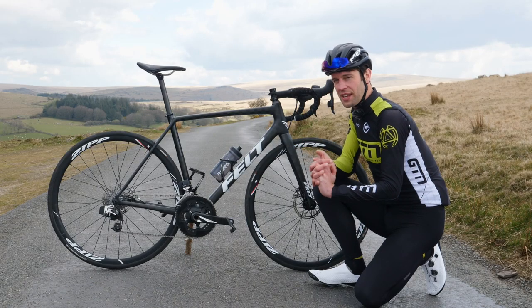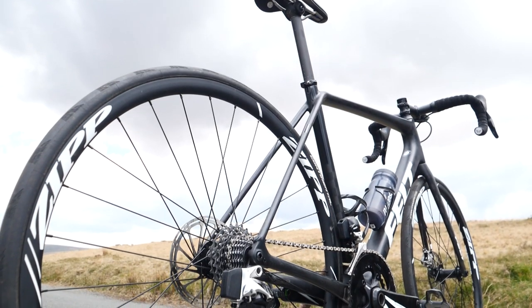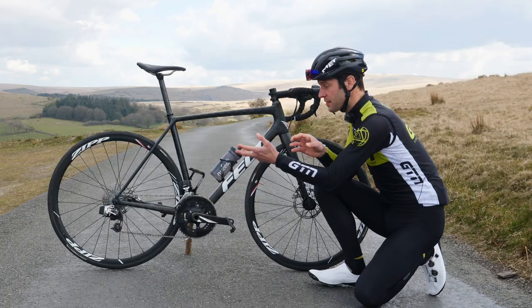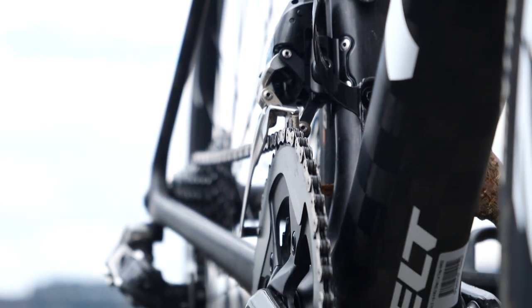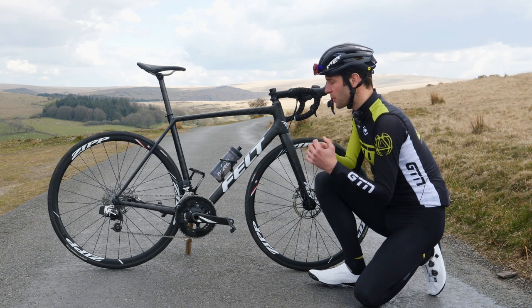What exactly are the gears? In the most simple terms, we've got the front gears and the rear gears, and they're commonly referred to as the chainset and the cassette respectively. Starting with the chainset, that's comprised of chain rings, a crank set, and normally a derailleur, which will switch between the chain rings.